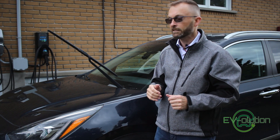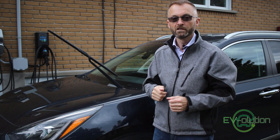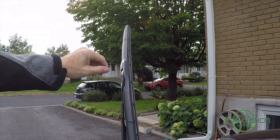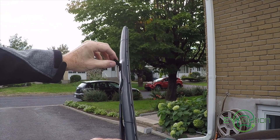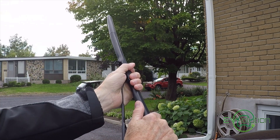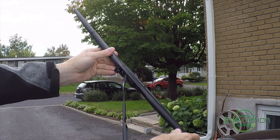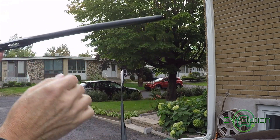Your car may differ slightly — some cars have different mechanisms where you have to push a little clip or there's a pin that has to be pushed — but in the case of the Niro EV it's actually quite simple. You have to start by pulling up this little latch. This is what holds the wiper in place when it's on the car. Once this is raised, tilt the blade and pull down until it releases. Make sure you pull quite hard, but don't jam it into the windshield and damage it. Once that's done, twist and pull off.